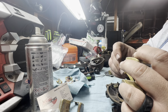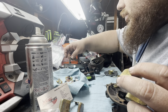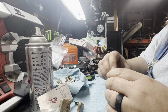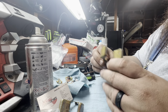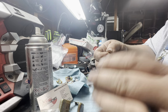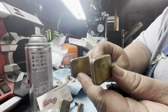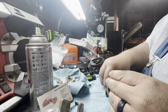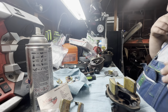All right. So what we need to do here is, see, how did that go on my old parts? Where's this needle? There it is. Oh, this thing didn't have, that might not use that. It might have just used the old hover method, but I bet it's going to be better because the other one didn't have this little clip in there. Let's see if I can show it to you. Little clip right there, and that clips onto the float like so. That actually helps. It helps pull the needle out. So what'll happen is we put this in there, not realizing that I did not really clean off this gasket material very well.